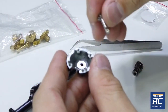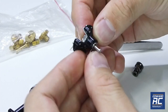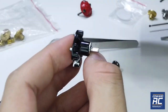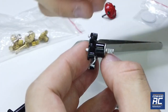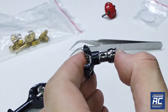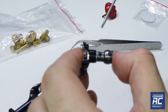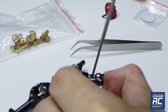The thickness is not critical since it differs depending on where you get it. In my case, over at the input shaft, I actually have to put a thicker washer. Then while installing the drive shaft cup, I need to push the input gear to this side, then make sure the hole aligns with the flat spot. Now install your drive shaft cup, and remember to add Loctite — otherwise I guarantee it will come loose by itself.